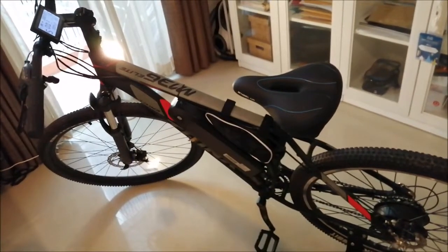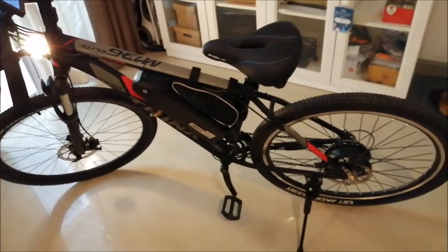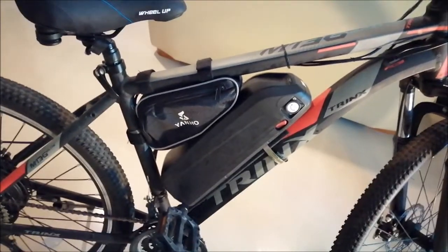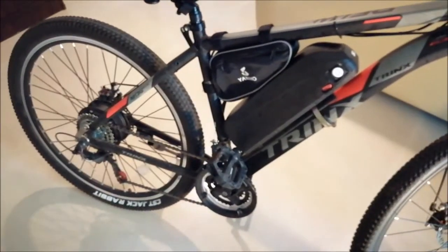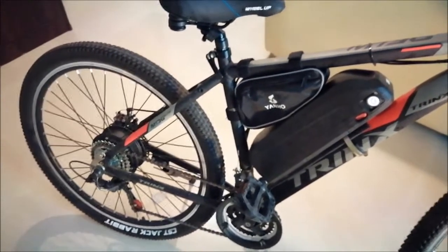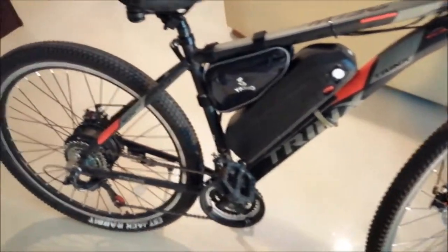I believe I could probably go for like this as basic version, and you can add on whatever you like to add on. At least we are custom, so there is no fixed rule about that. I believe if you take a random bicycle, the only thing you have to really care about is that you have enough space in the frame to fit the controller or the battery, or come up with another location for these items. But I like the weight distribution like it is, because in the back there is the wheel already. So if you put the battery pack on top of it, as some people do, it will shift the weight magnificently to the rear wheel. And that's maybe not a good idea. Normally you want a balanced bike, and I think this bike is pretty balanced at the moment.